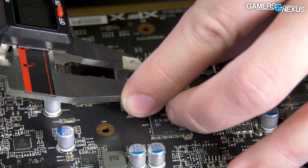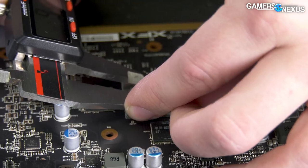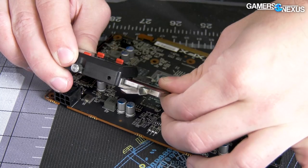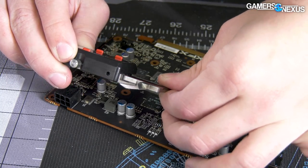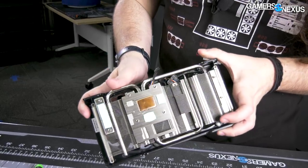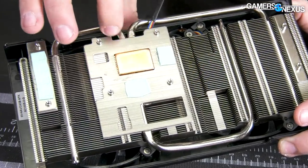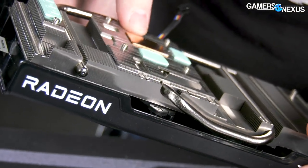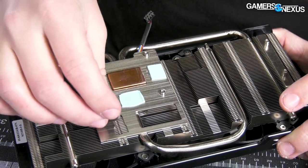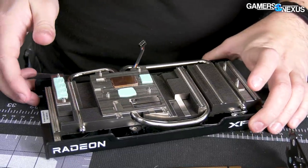This is not going to be exactly precise — this gives us the diffusion barrier size but not necessarily the silicon underneath. Approximately 7.7 to 7.8 millimeters by maybe about 13.4 millimeters — pretty similar to the size of a chiplet, maybe a little larger. So basically we've got a copper slug and a plate. I think that might actually just be aluminum or a non-magnetic steel. Copper slug, plate, heat pipes — that's about it for the cooling solution.